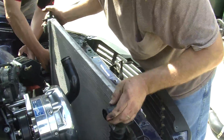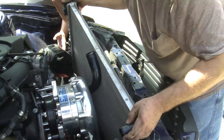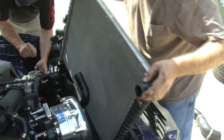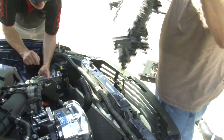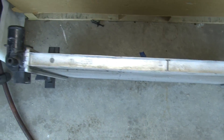That means 18% more surface area — but it gets better than that, and that's only the beginning. It's also three rows thick. Your factory radiator is one row thick; this is three rows thick. So you've not only got more surface area in the front, but you've got more depth, so there's more cooling all the way through it.